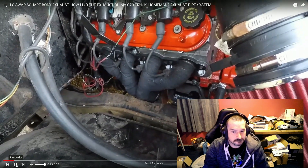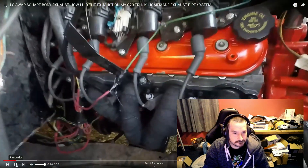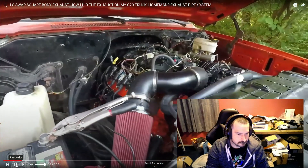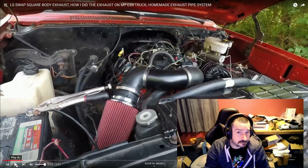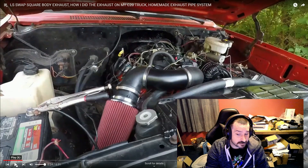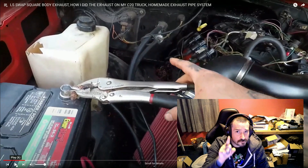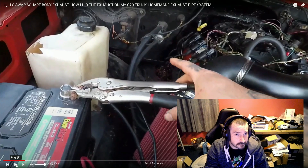These cheap eBay headers and manifolds are the ones that work for me on this, because I've got a PTO down there. Now don't mind the wiring — the wiring is not done. Side note: that plug was touching the header. You need to dent those before you have a problem, because I didn't do that and they burn wires pretty often. I gotta carry some behind my seat. I'm planning on either trying to dent them or upgrading to ceramic spark plug wires on this engine.